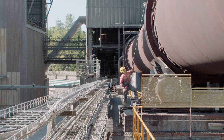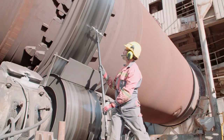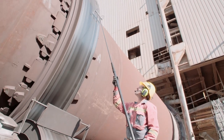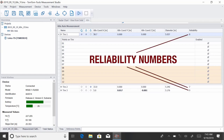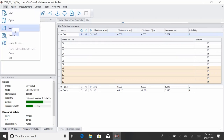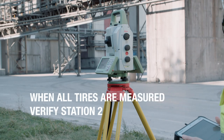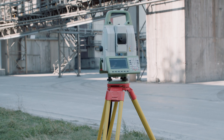The ball swivel can be mounted between the pole and axle to facilitate the measurement of points which are difficult to read. How reliable the center positions of each tire are is indicated by the reliability number, going from 0 to 10. Make sure that the reliability numbers are higher than 6 on all tires. Don't forget to save the file from time to time, and check here as well if the theodolite remained in exactly the same position and was not accidentally moved.